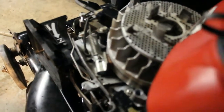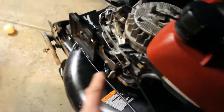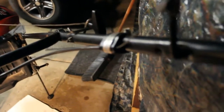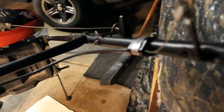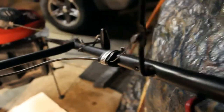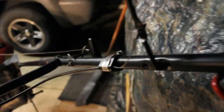There is a cable here that controls the choke and also the kill switch. There is a cable which hooks to the handle — this looks like someone put a replacement on there. It was rusty inside the cable and very hard to pull. So what I did was take some three-in-one oil — you can also use WD-40 — and just spray a little in that hole. Every time, just work the handle, keep working it, and eventually it ran smoothly. So we've alleviated that issue.